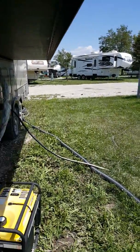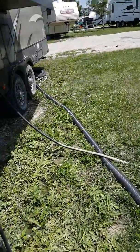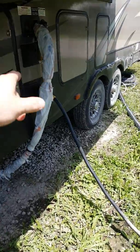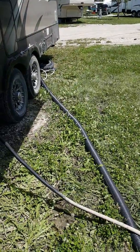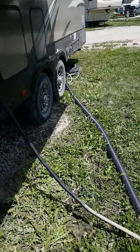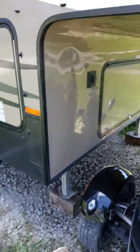If you ever have a camper and you're hooked to power and the power doesn't work, there are ways to go about it. The quick and dirty: if you have a voltmeter, check the end of your power cord when it's hooked to electricity. I'm talking specifically about 50 amp — you should have two hot leads, two different 120s coming through. If that's correct, you've got power coming to the camper.